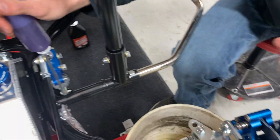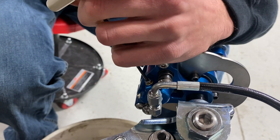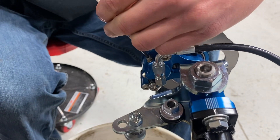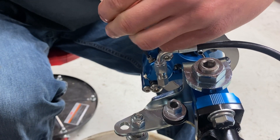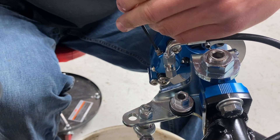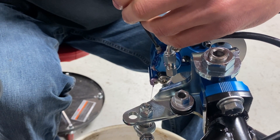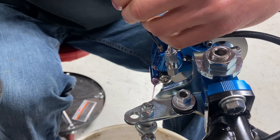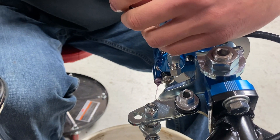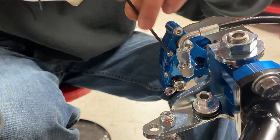Put the bottle on that side and get our 7/64 allen wrench in place. This is easily a one-person job, but sometimes a two-person job — just depends. With pressure applied on the bottle, squeeze fluid through the left front brake line until you get a steady stream with no air bubbles. Pressure is still applied on the bottle and then tighten that screw up.